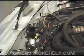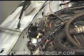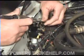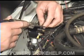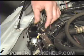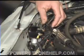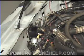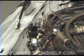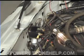Let's take a look at this starter solenoid and see what it takes to make it work correctly. The starter solenoid needs to have incoming power here correctly. You pop this off — this comes from your ignition key. Set it here in such a way that you can see it from inside the truck if you don't have anybody to help you. I'm going to go over here and turn the key. The truck won't start, but you see that light coming on? Every time I turn the key, that light comes on.